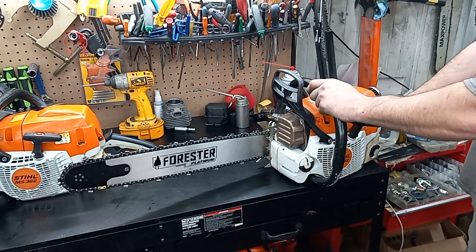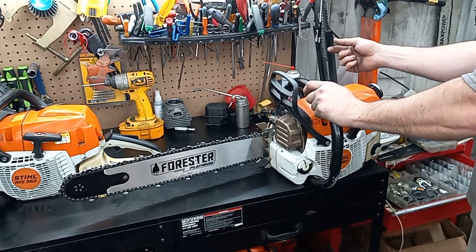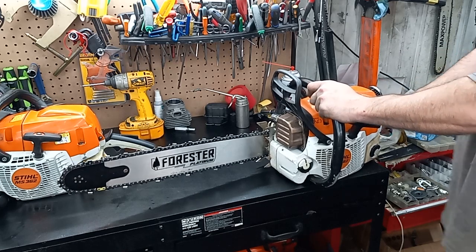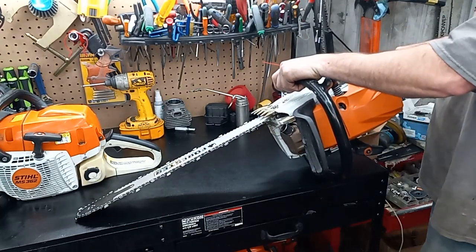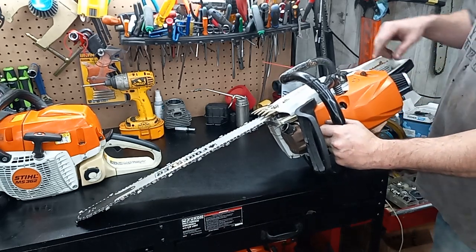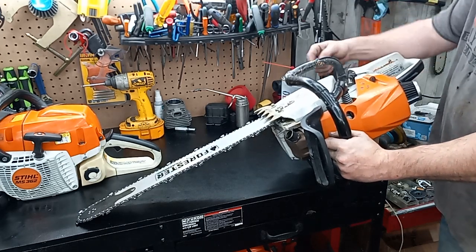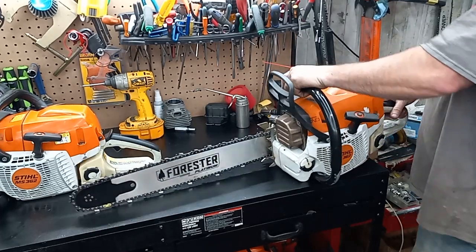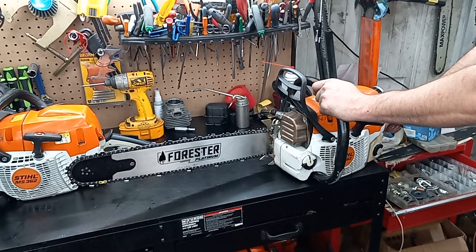I could even make this go stiffer if I wanted. I could probably put some sort of smaller fuel line inside the 3/8 and 5/16 fuel line that I put in there. But I think this is just about right. It's not quite old school feel, but it's not flibbly flobbly feel. Also built me a spacer in here to take up some of that slop, and on the 2 mounts as well. So this thing should be pretty good cut and saw. Just wished it was on a 105 roof, but such is life.